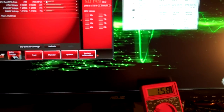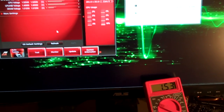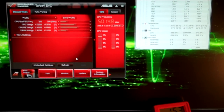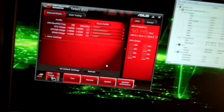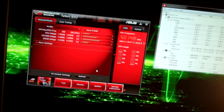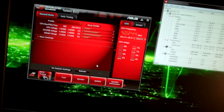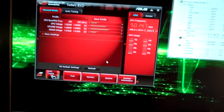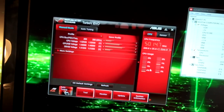I guess that's going to do it for this chip. I'm going to lower this voltage before it blows the hell up. So, 5 gigahertz I cannot get stable. I can get stable at 4.93 gigahertz at 1.525 volts. I could probably get a little bit lower, haven't tried it yet. But once I increase the multiplier to 25, front side bus 200 megahertz, and the CPU voltage up to 1.58125 volts, I could not get stable. So there it is for this chip — I think that's as high as it's going to go. I will install the other chip and we will do the same thing and see if we cannot get more out of the 8120.